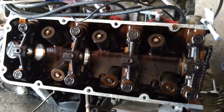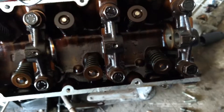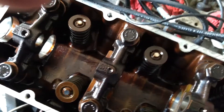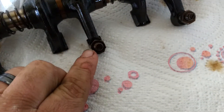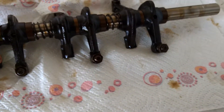On to what you've got to do. I would have filmed this while I was doing it, but I was actually learning to do this myself for the first time. It basically consists of pulling out the oil supply or the rocker shaft separately. How you do that is: you're going to line up your timing, take the valve covers off, take the timing chain cover off, and you're going to loosen up all the rockers here. When you do your valve adjustment on this car, you have your nut and you have a screw right here — that's how you adjust your valves. What you're going to do is loosen this up a little bit. Make sure you put the nut back on there so you don't lose it. And loosen that up to where the rockers are kind of free-playing a little bit.